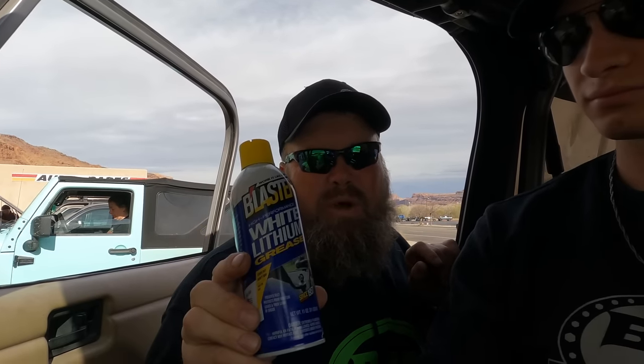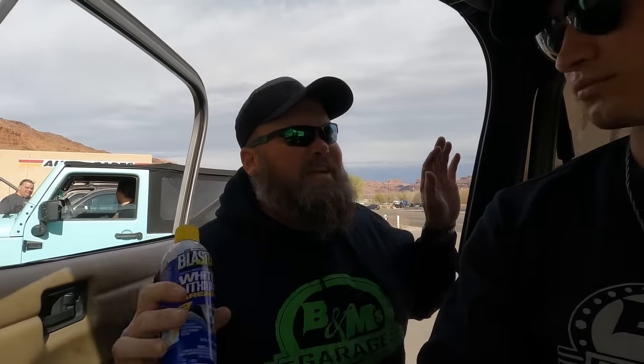Okay, we could not contain it, we had to do it. We had to go get some white lithium grease and spray the brackets on the seat. It was driving us insane. Yeah, we were both going a little crazy. So now it's better. No more squeak. See that? No squeak.